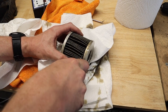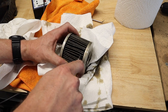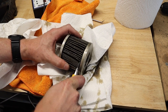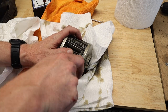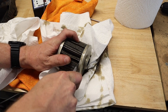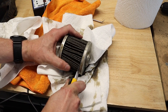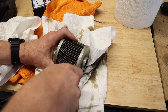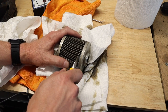You can get a pretty good look just by looking through it, but to get the best look — I mean, if you've got some serious problems you're going to open this thing up and go, 'Oh man, there's a lot of metal, I can already see it.' But just to be extra sure, we're going to cut this filter all the way out so you can get a bunch of paper towels, wind it out, and look in detail to see if your engine is producing any type of metal.